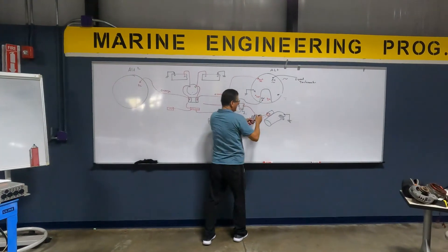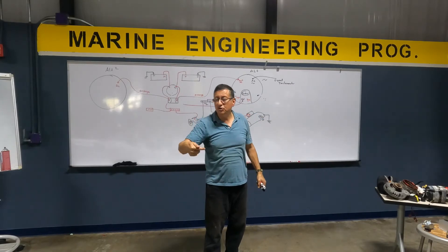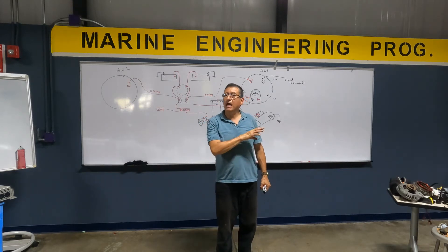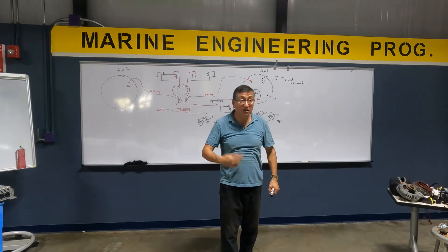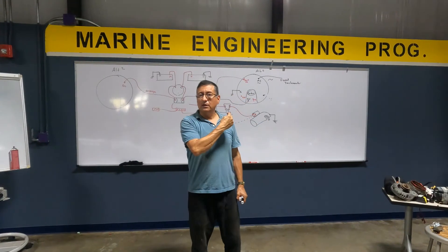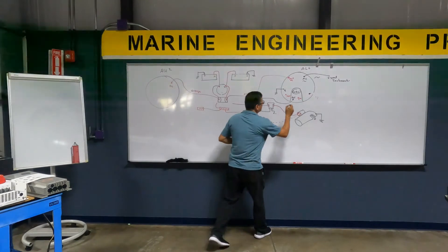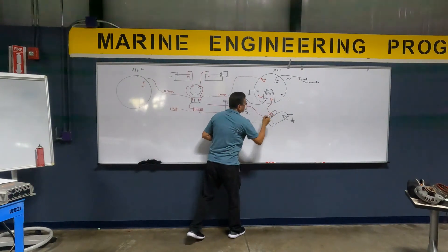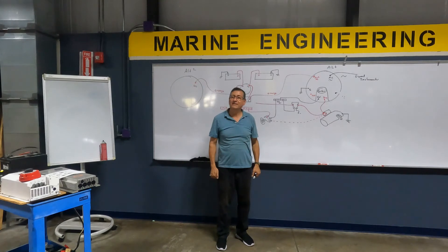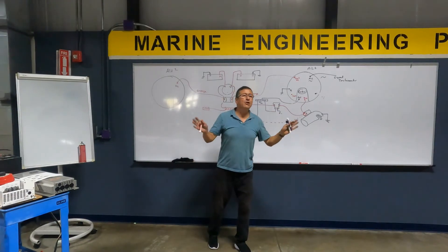This area in the alternator is the exciter. What happens if the engine is running but suddenly the excitation cable — the purple cable — is open, broken, or disconnected? The alternator does not produce more power. It's spinning but not producing power, because there is no excitation. For that reason, some alternators have a backup excitation — double excitation. They have another cable, the sense cable, connected to the big positive of the starter motor. Because that big positive has power all the time. If for some reason the excitation cable is broken, they have the sense cable as backup. Double excitation for safety.